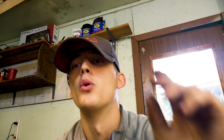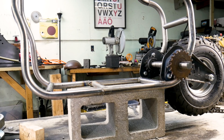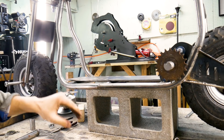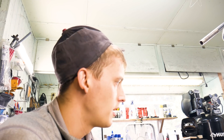Welcome to the next part of the diesel minibike build. Today we are doing the meat and potatoes of the build: setting up the jackshaft, aligning the chains, putting in keys, lining up the motor and mounting it. This thick engine mount spans the entire length of the bottom of the minibike, so it will be nice and sturdy. Everything's going to be size 50 chain, making it a super sturdy minibike.